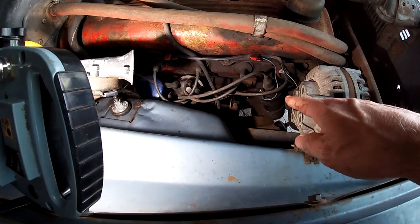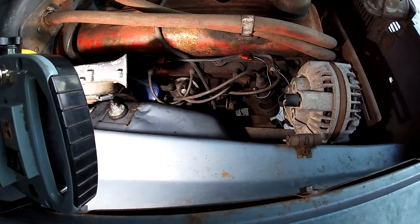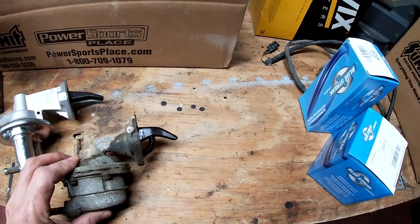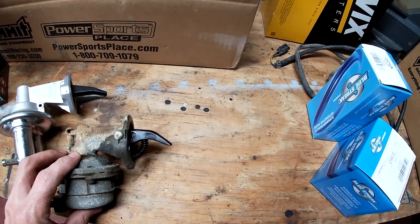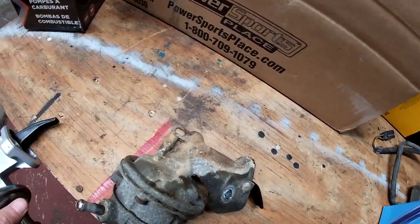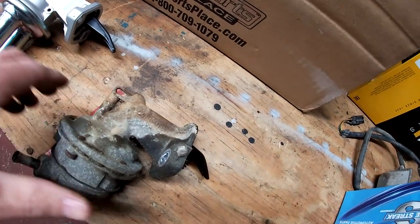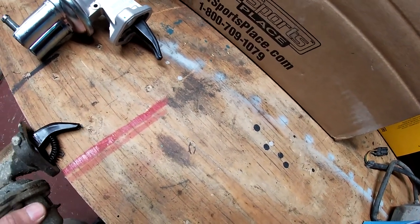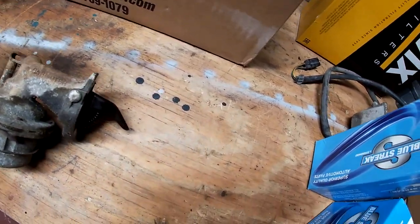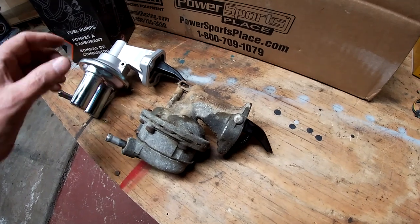It's out. I don't feel a conventional rod, like in the V8s. Feels more like kind of a lobe of some kind. I'm not sure. I never really worked on a slant six. And when comparing the old one with the new one, obviously they're different, but does the arm show up in the same spot? It's kind of hard to tell, but I lined them up against this, to a mark, I think that paint mark. They get to the same spot. They just take a different trajectory. And this one is, you know, like a millimeter longer. But it's hard to tell just by looking at it here, but it should work.